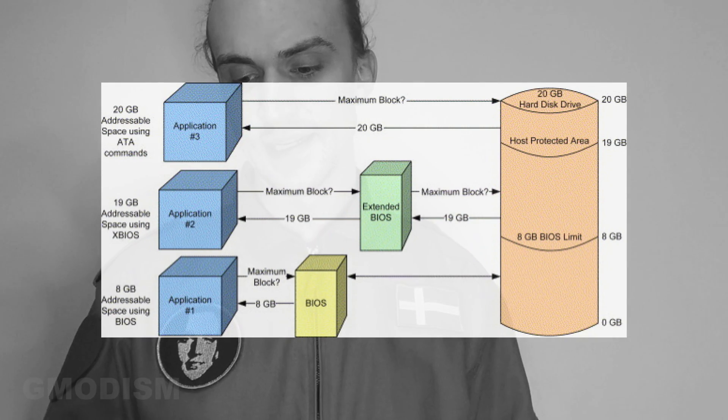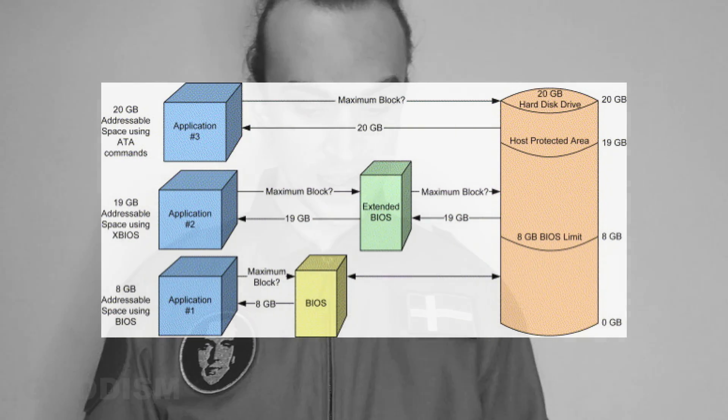This bypasses BIOS and the Windows OS. The reason this is good is because of something called HPA — host protected area — and DCO — device configuration overlay. The HPA can store system restore images and some other files, but some rare viruses or rootkits can install themselves there. The NSA also uses this area to install software to monitor target computers. If you had a virus in that area and wiped the drive using diskpart and gave it to someone else, they might get that virus — diskpart doesn't delete the HPA area.